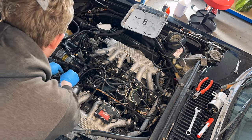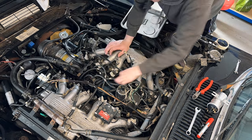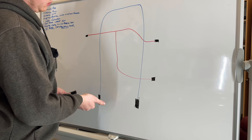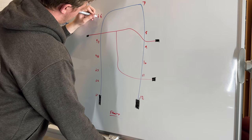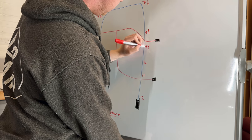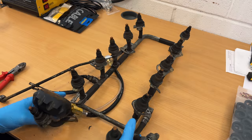There we go. I'm going to get some masking tape and put it where those injector holes are. I need to remember the orientation of all of the electrical connectors to line up with the connections. Connector one, two, three, four, five - a little forward. And the other side mimics that side. Forward, forward, forward. The next job is to cut the injectors loose from the rail, keeping them in order.